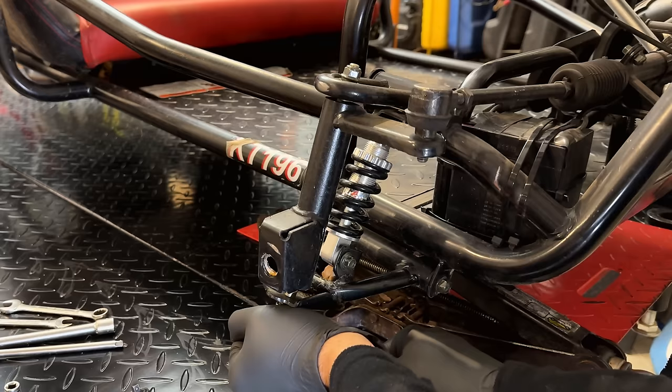which I believe actually is going to be the black one. That'll go to the ignition coil. So that'll go in right there. And for the other side, we need battery positive, which is that guy right there. That's going to go to the middle tab on the other side.